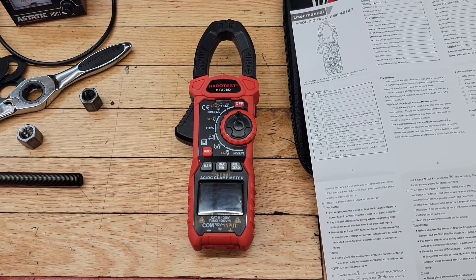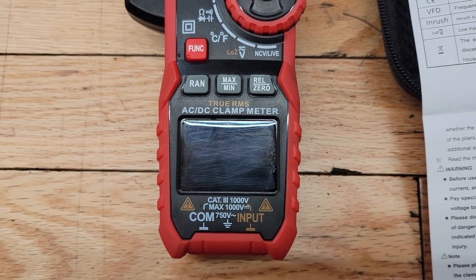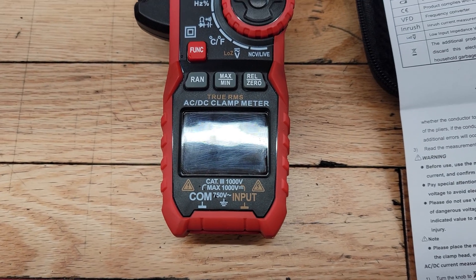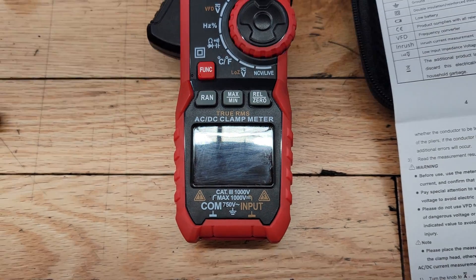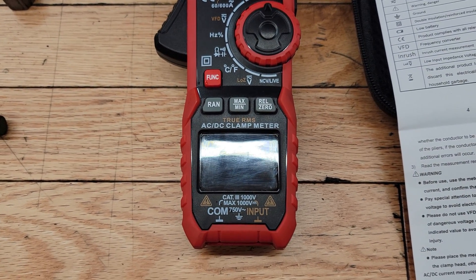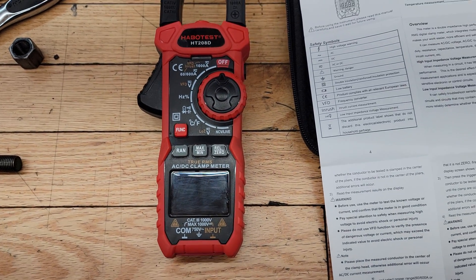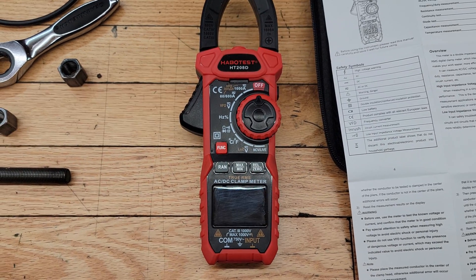That's a good way to test and see what the amperage draw is on your grid heaters as well as your starter. It's also a good way to check if your grid heaters are working — if they're not working at all, they're not going to draw any amps. The fact that both grid heaters were drawing about 240 amps including the rest of the system tells me they're working as designed and functional, as is the starter motor. Thanks for watching guys, stay tuned for the next one.